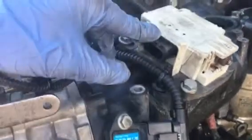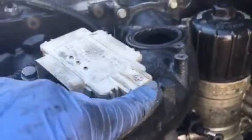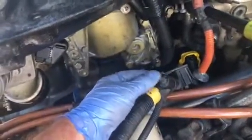You don't really need to connect that heater because the system is not working anyway. If you pay attention, there are two plus and minus connectors which are never connected. Detroit left the harness connector for it, but it was disconnected at the factory, so it's not working.